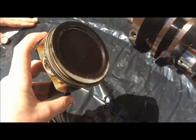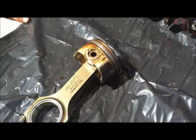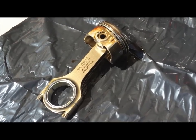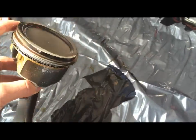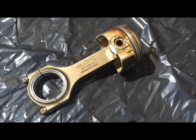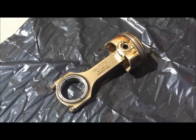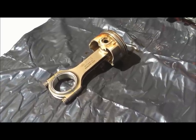The pistons were all forged aluminum from a company called Zollner. A lot of people say this is the weak link of all the forged components, and that's probably true. However, a lot of the problems you have with engines giving out on these cars has more to do with the fuel - with the car leaning out or not running the right octane. The pistons take most of the hit, and a lot of times you'll see chunks missing out of the top, or as in our other one, you'll see the pistons melted completely. The forged connecting rods on these cars are rated around 600 to 700 horsepower, but they've held up to 1,000 wheel horsepower. A 600-700 wheel horsepower Cobra will hold that power all day as long as you're feeding it correctly with not too much ignition timing and using the right fuel.